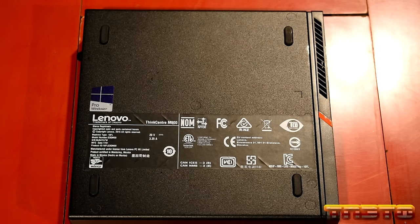Intel management. Okay, so here's where you can reset the Intel management. So we're going to do that. And it shows the current firmware, which, when we go to discuss Intel vPro and AMT and, you know, ME, the management engine, we'll discuss updating the firmware and how this all works. But we do want to reset this. So if it is enabled, Intel management settings will reset to default. The MEBx password will also reset. You want to do this on these units, okay? So we'll go ahead and do that.